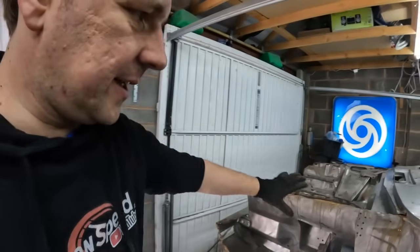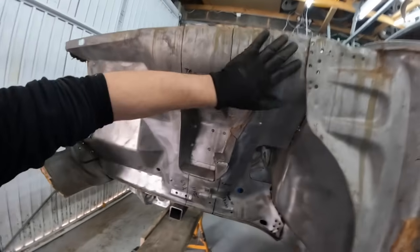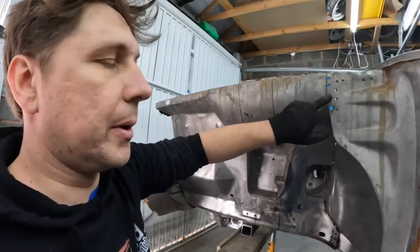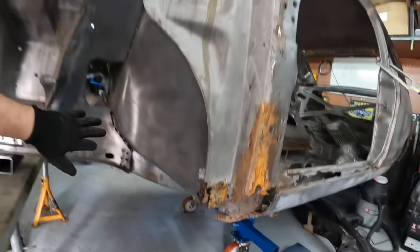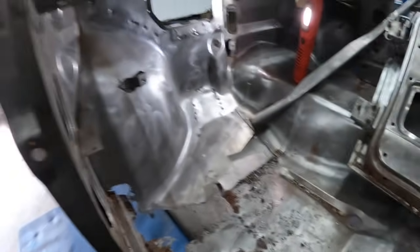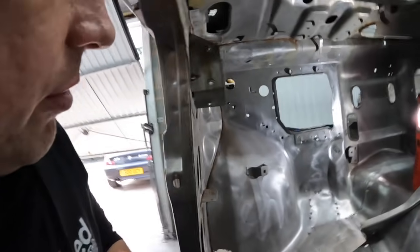I've got a lot of this front near-side all drilled out. I've used an 8mm drill bit because I'm not interested in reusing this panel - if I was, I'd have used a spot weld drill rather than drilling all the way through. I've done the same on the bulkhead and the floor, because the chassis rail here is all coming off. Anywhere left with a hole in the floor is basically going to be a new floor, or if it's on the bulkhead we can back-fill them with weld. I'm going through now with the spot weld chisel just to try and ease them off.